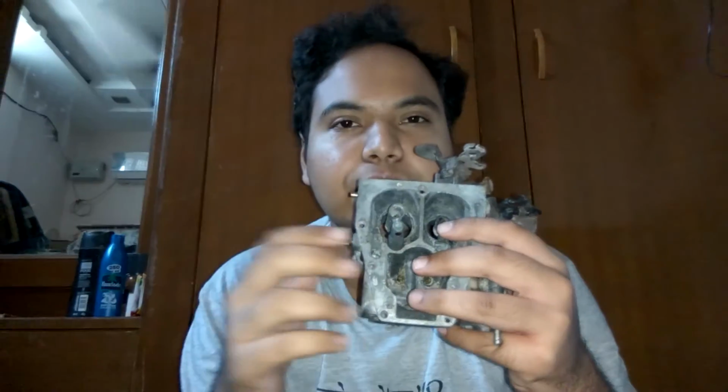I would personally suggest that you leave the primary jet alone, but then you can go about modifying your secondary jet. The bigger the secondary jet is, the more noticeable gain you get once in a while when you want to floor your car and get past everyone, and then it helps. So get a bigger secondary jet, but not a bigger primary jet. Reserve this for your mileage.